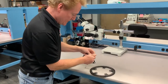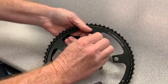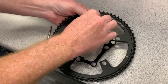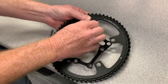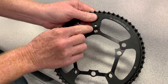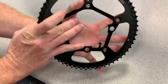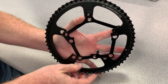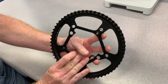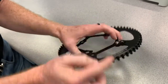They've provided screws intended to be used in a specific way — this screw is barely small enough to sneak through the adapter ring. So as long as you have a situation where the spider, the adapter ring, and the sprocket are all stacking axially outward, everything is fine. But if you need the spider on the same side as the ring, the screw arrangement they provided just won't work.